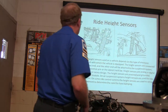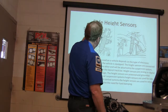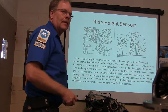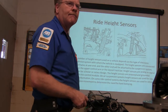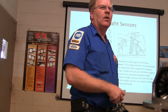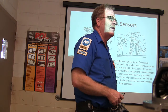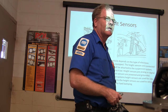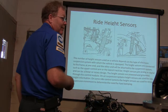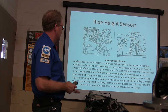It's sort of like an alerting cycle. It's going to be hooked to the body and the suspension so it knows the ride height. If you're doing an alignment check, the only thing you'd want to do is turn off the air suspension so it won't be jacking with it while you're trying to get it set. The analog height sensor has a continuous voltage signal that's just changing in relation to the vehicle height.